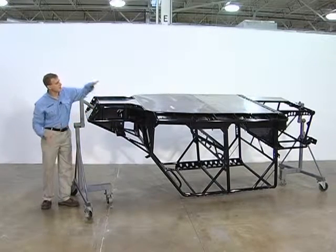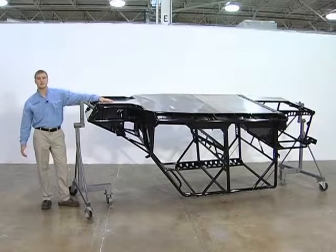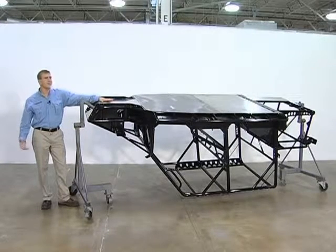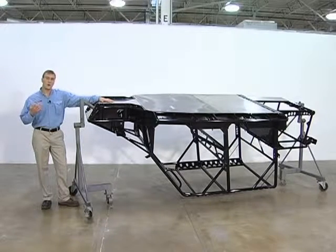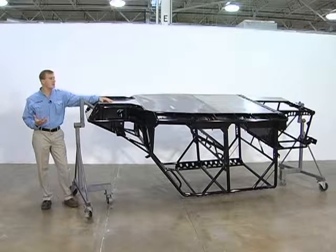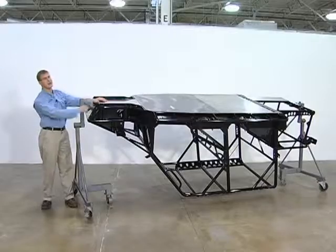Once it gets to the end of the guide, it gets transferred onto our perfectly flat skid plate that you can see all the way back. The skid plate is covered with aircraft-grade aluminum. The reason for the aluminum is that it tends to slough off when sliding over rocks and obstacles, whereas steel has a tendency to bite in and slow down momentum. By having that, it allows you to continue momentum and keep sliding all the way to the back of the vehicle.